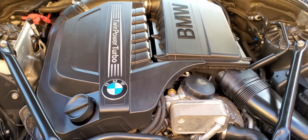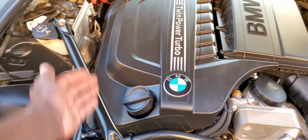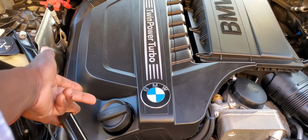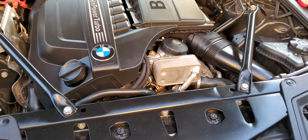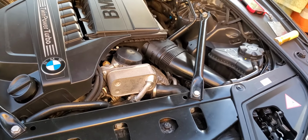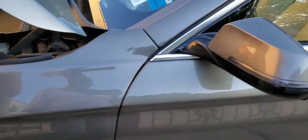No, I went to a BMW place and they started to diagnose. Usually on this side, I realize that sometimes there is a vacuum line and two or three solenoids here. Sometimes if it is not connected, it puts the car in limp mode, but it will not stop the car from starting. If the battery goes dead, it can activate the rolling code of the security. So now we're going to put the machine on and scan it, and then we see what possibilities we have.